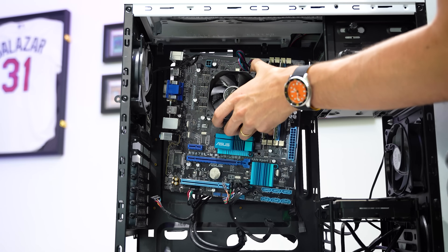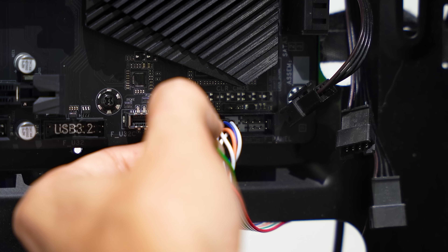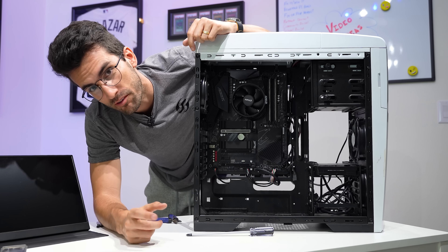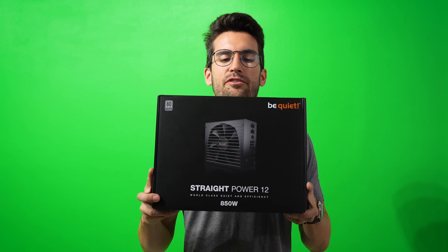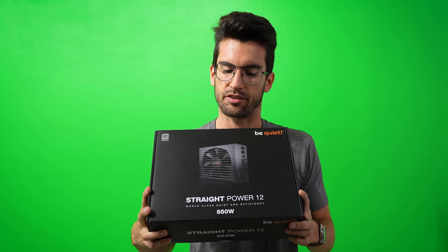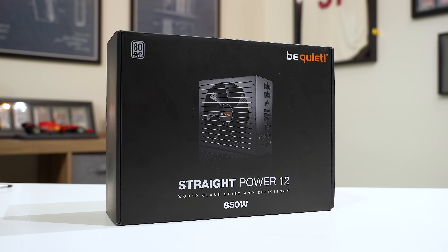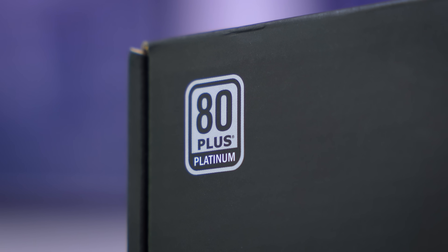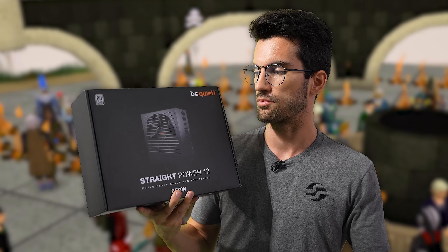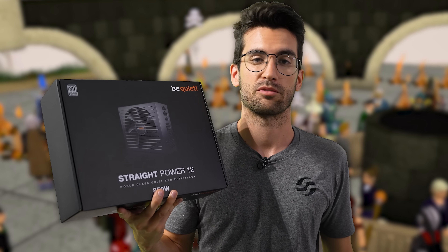Platform is next — we'll also scrutinize this a bit later. We've got some tangled cables. Tightening the new board down. Front panel is going in. And now it's time for that new power supply, courtesy of — you probably didn't see this one coming — Be Quiet. This will most certainly be overkill for his current setup, but we have a Straight Power 12 850-watt unit from Be Quiet. This is going to provide him plenty of power headroom, obviously for the future, but it's also going to give him peace of mind with a great warranty and a fully modular setup. This is a beautiful design — also super efficient. This is an 80 Plus Platinum unit, something he could take with him to the next system in the future if he decides to upgrade, or if he just wants to sell it. There's no way that original power supply is going back in.